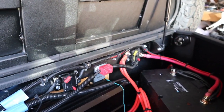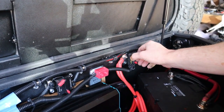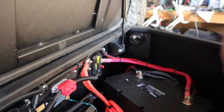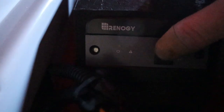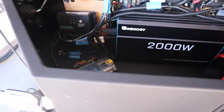From right to left we're going to check these circuits and make sure everything is working, starting with the 2000 watt power inverter. I do have a load on it already just in case — there's a 110 volt outlet here and one on the back of the trailer we're going to try out. I wired up the remote switch — I heard it beep — the power inverter's on! Light's working, awesome, fantastic. Let's go check the back outlet.